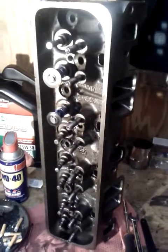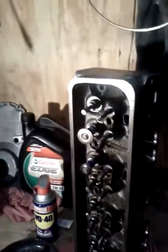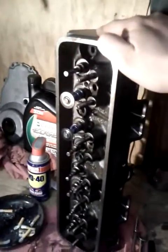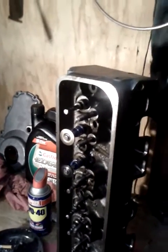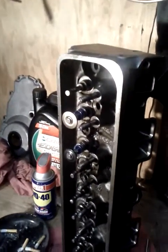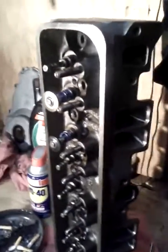There's a cheap upgrade for small block Chevy heads. This is a 1988 LM1 350 head, also known as the L98 cast iron head — a cast iron version of the Corvette head that year. It's not bad. I got done porting it earlier.